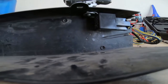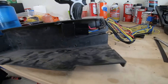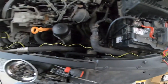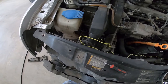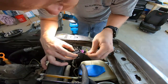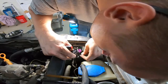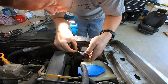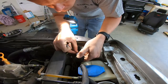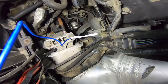Since the US market headlights didn't come with factory fog lights, I had to mount a relay and wire up the fog light harness in order to get these new lights to work. Here I am pinning the passenger fog light into the OEM plug. I used a coat hanger and tape to feed the fog light relay wire through the firewall into the headlight switch.